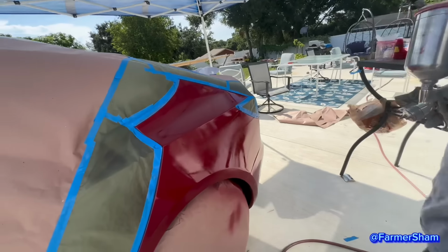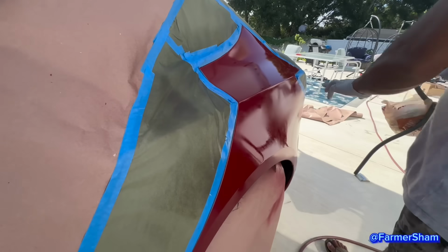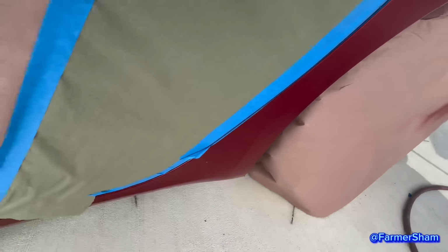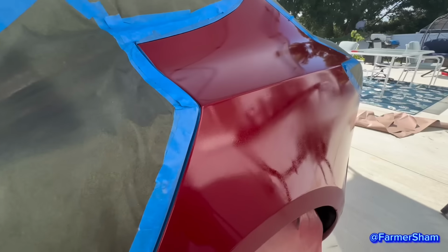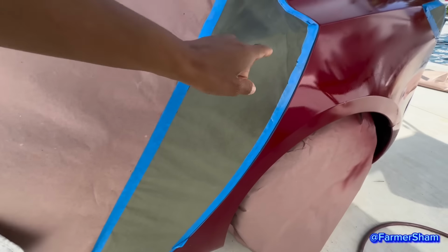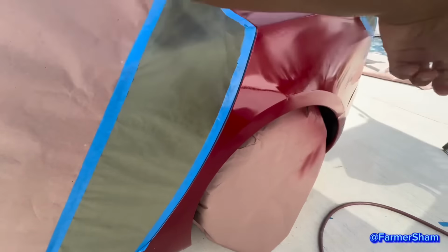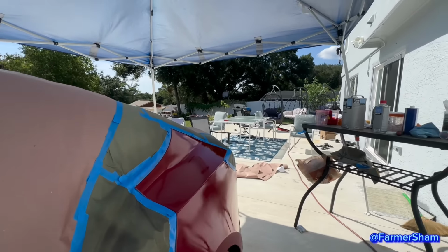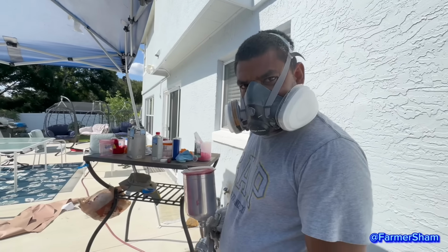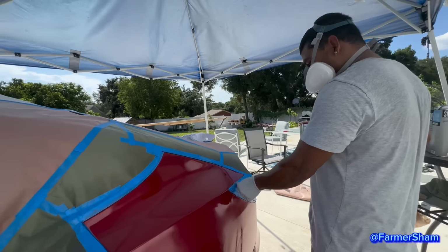As we wait to do the second coat of clear, and this is the blending clear, because he's gonna blend it with this end here that he didn't. So this is the first coat. And then the second coat will blend down here, and on the back wrap around the bumper. How long does this have to dry for? 5 minutes?